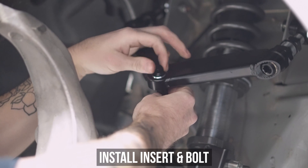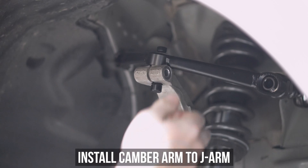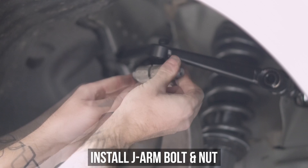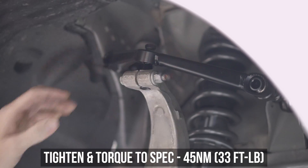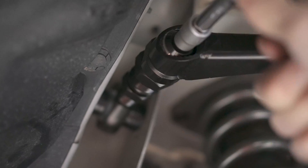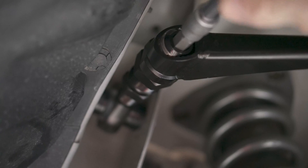Go back to the car and install the insert and nut, then tighten them down, lift the arm up, and pop the insert into the J-arm, running the bolt through, making sure the divot is aligned with the J-arm bolt. Casually slip the nut on, tighten down, and torque to the settings shown. Head back up to the threadlocked top nut — that's four times now — and tighten down and torque to those settings as well. If you need to do any in-car adjusting, you can use the hex head socket to extend or contract the arms. Just make sure both sides are adjusted evenly using proper measuring tools.